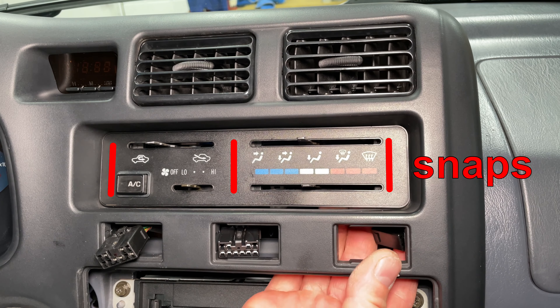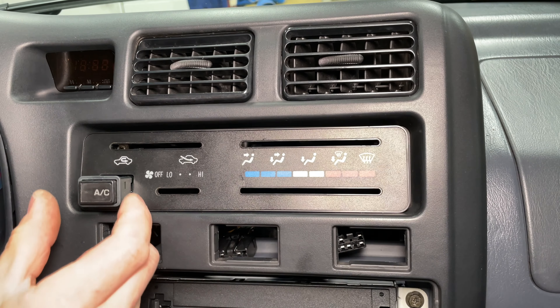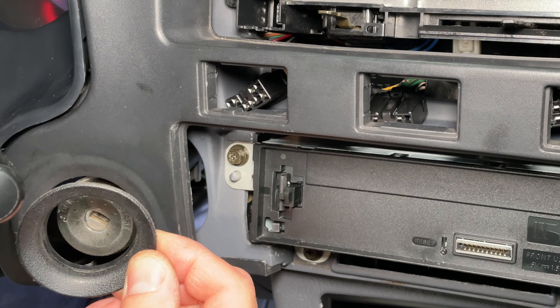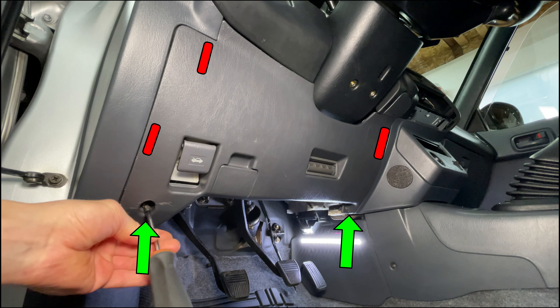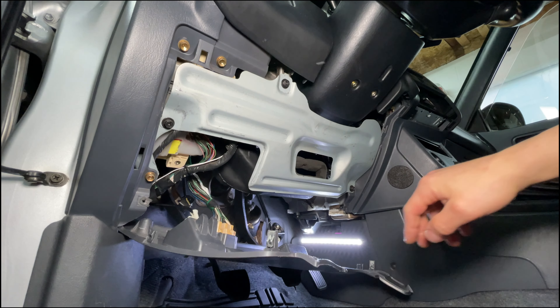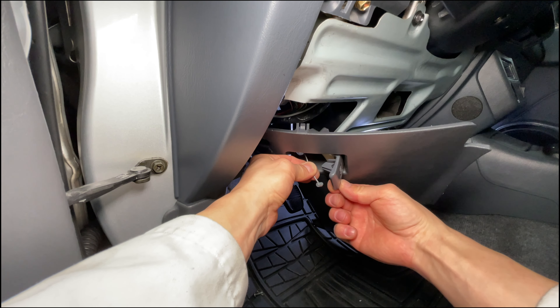Put your fingers behind the plastic to release the clips holding the climate control trim. Pull out the AC button and bezel. Remove the rubber ignition switch ring. I arranged the parts neatly on the passenger floor mat to keep them organized. Remove two Phillips head screws from the plastic trim under the steering wheel and pull the panel toward you to release the clips. Pull out the fuse box and take the cable out of the hood release handle — it's a little bit tricky.